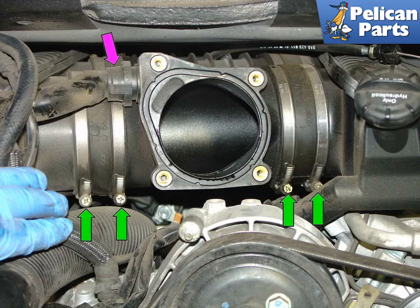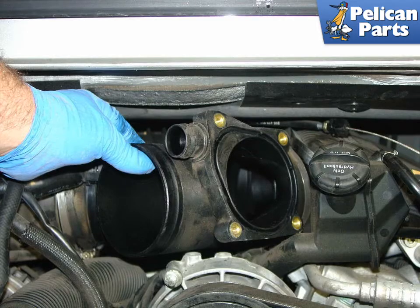It's a good idea to loosen the inner hose clamps first and then rotate the plenum to help break the seal that may have formed between the rubber. Then tighten the inner and loosen the outer clamps to break the connection between the rubber seals and the intake manifolds. Sometimes they can stick together, making removal a bit difficult, and this will help free them up. There is not a lot of room to work, so anything that makes it easier will help. Once the hose clamps are loose, push the intake seals into the plenum, then slide the plenum over to one side and pull it free of the manifold.